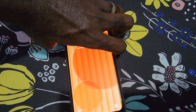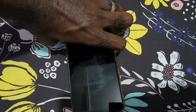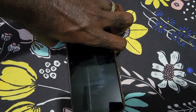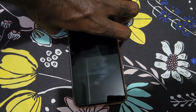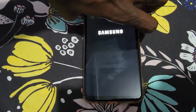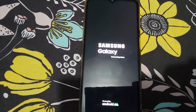Unlike mine that came on immediately, yours most likely won't come on right away. You'll have to press and hold, and then all of a sudden, in most cases, you'll see a Samsung logo pop up. Once you see it — there's the logo — go ahead and let go of the power and volume down buttons.